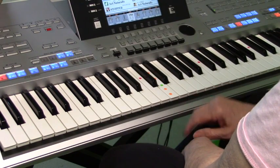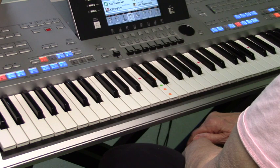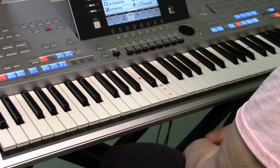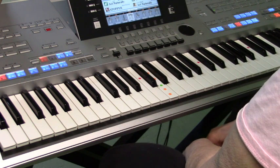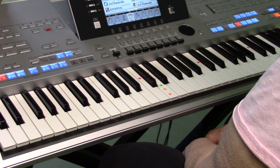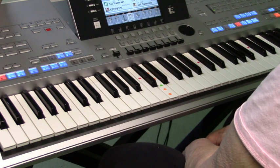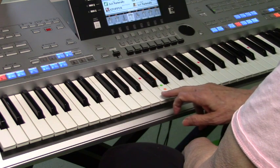Okay, what we have here is a Tyros 4 with intermittent action on the D3 key. If possibly the contacts are bad, we will have to disassemble and inspect it to see if it needs cleaning or replacement. We have a sustained sound at times. Sometimes the key is completely dead, and other times it's just at a low volume. Here we go.